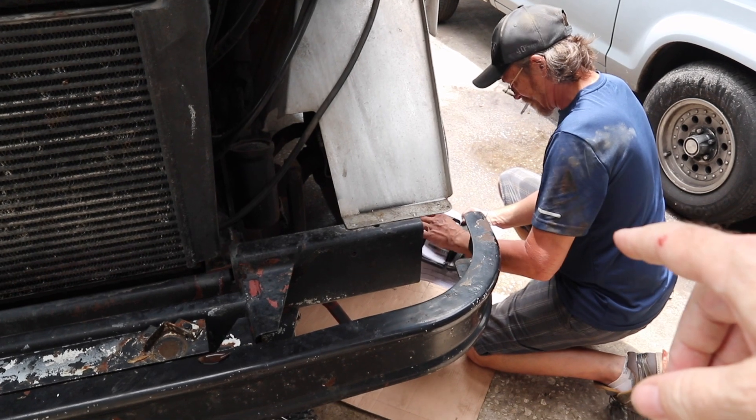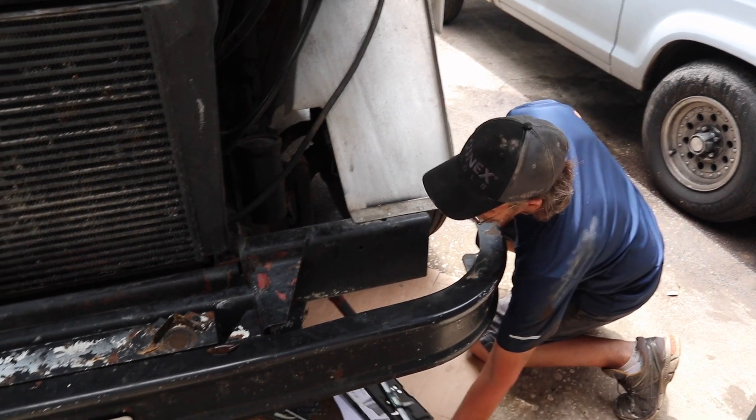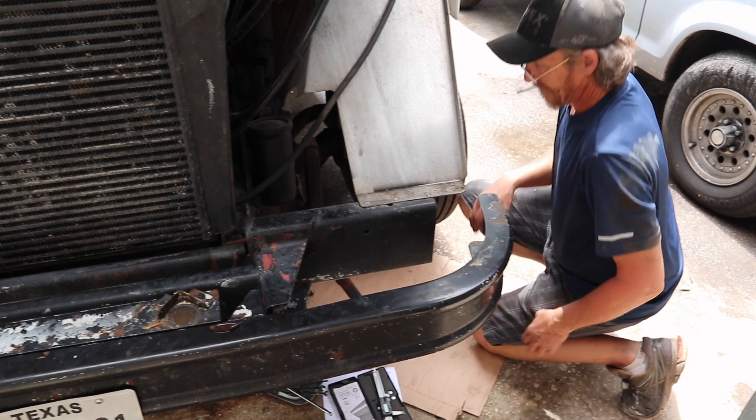The mechanic is installing the last part, crawling underneath there, so hopefully in a couple of minutes we'll have a running step van. We just did a test up front — crossing fingers — but failure. The engine didn't even click, didn't start, no lights on the dash, nothing. We went and looked at the battery: a brand new battery installed just a day and a half ago was completely dead. Apparently something is draining the battery.